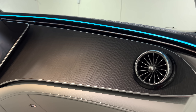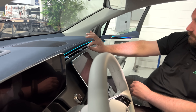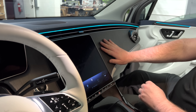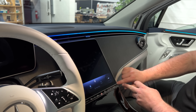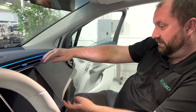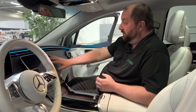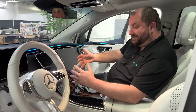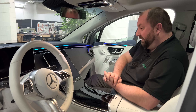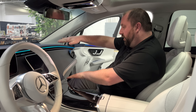Let's look at this IP. We have this large section — but what is in it? We have a wrapped top pad, a decorative light pipe along the air vent, and then this large dead space with wood grain in it. I don't know if this is real wood grain or simulated wood grain. They have a decorative edge all the way around it. That large dead space is most likely due to packaging — they probably have a lot of stuff in this instrument panel that they had to stack. But by trying to keep a sleek exterior to the customer, they end up with this huge section that's basically just acting as a closeout panel, creating a very tall dead spot and a very high IP to my eyeline.